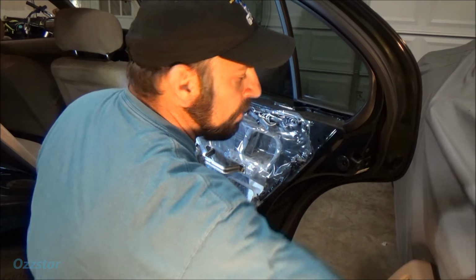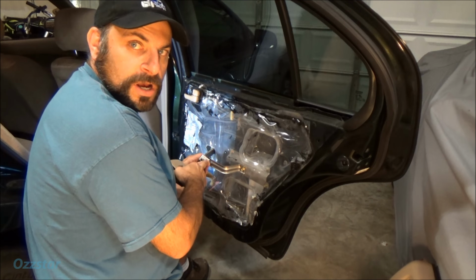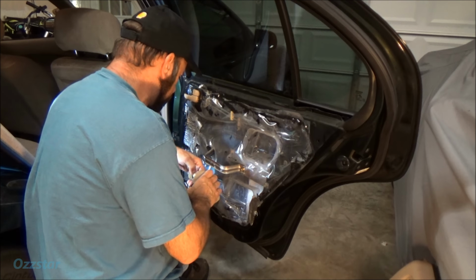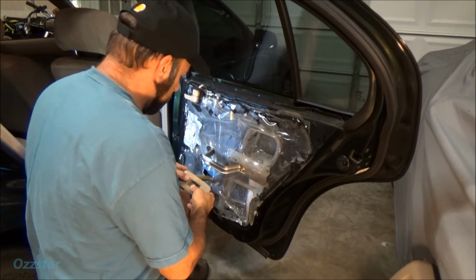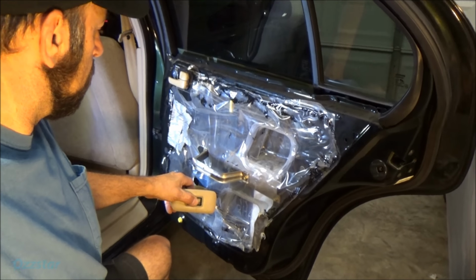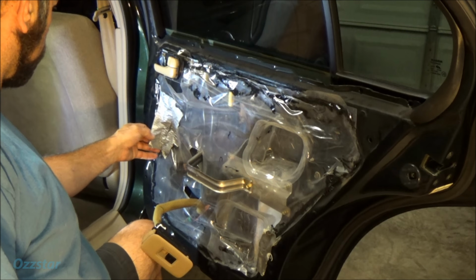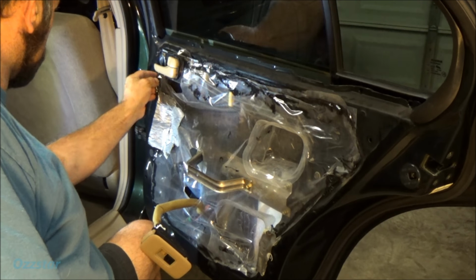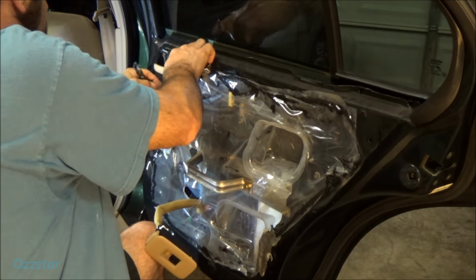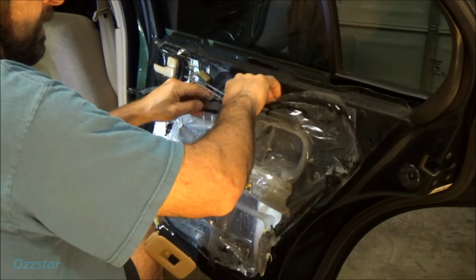And then what we can do, to diagnose this and make it easier, I mean, we can put 12 volts here and ground, power and ground, but I'll just plug the switch back in like this, and now you should be able to hear it clicking pretty good. Let's zoom in. It looks like somebody's been here before. Let me pull this 200 mile an hour tape here. This is just a clear vapor barrier, and it's on here with some butyl. It's like that black sticky stuff.